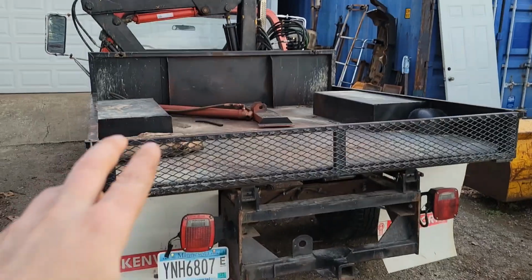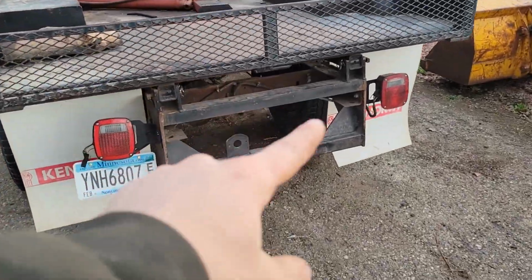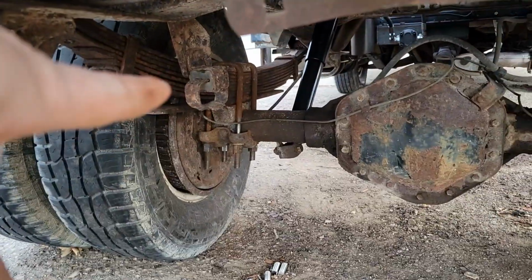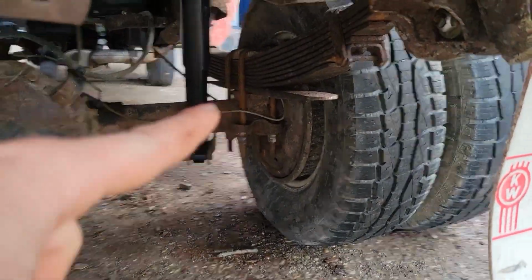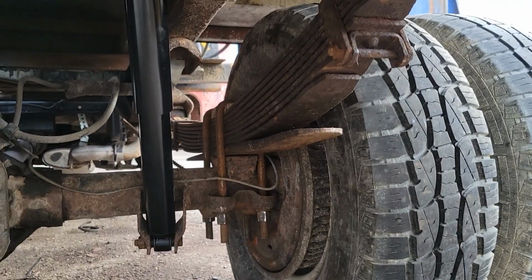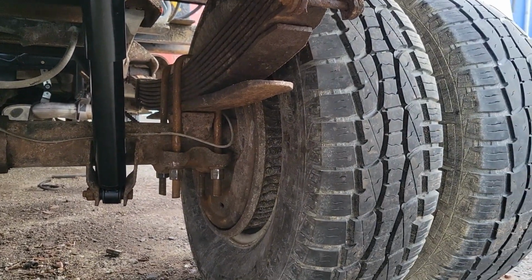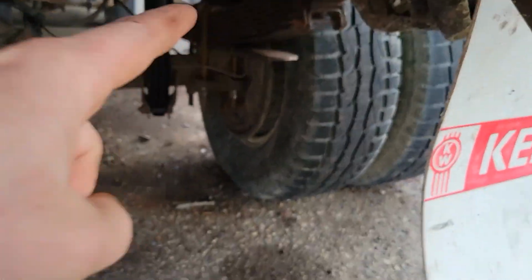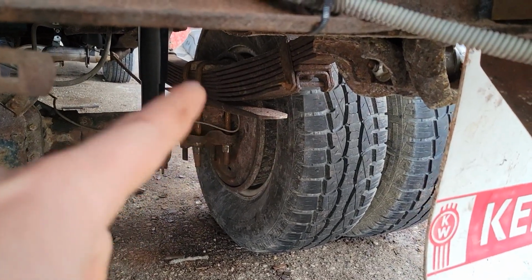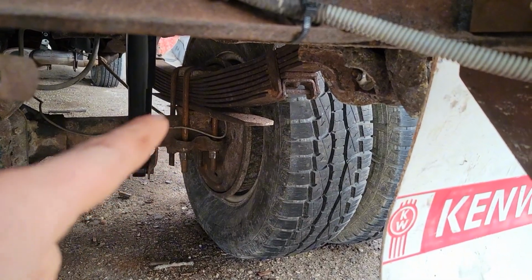All right, guys, we are back, burning daylight after work again. After I cut the cameras off last night, I went ahead and buttoned things up here. Got the springs bolted in with pretty much no problems, except for this one didn't want to seat quite well. If you look, there's a little bit of gap at the bottom of the spring between the perch. And there's not a lot of room in there. All I can really swing is like a 4-pound hammer. And there must be some sand or rust underneath that center pin.